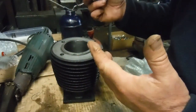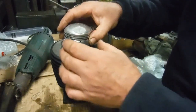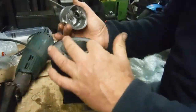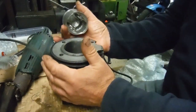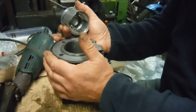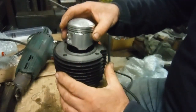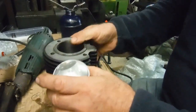This is all my theory — I'm no scientist — but I'm talking from experience. I think what happens is if you've got an aluminium piston in a cast iron barrel complete with cast iron fins, the expansion rate is obviously going to be lower, but it's also the time for it to expand that's going to be greater.